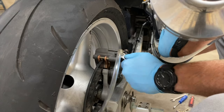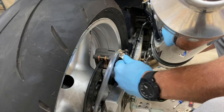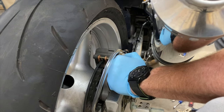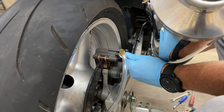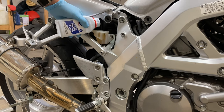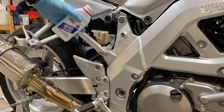Here I'm just making a little container to drain the brake fluid into. To bleed the brakes, all I do is pump the foot lever a few times, hold it down, then crack the nut open about a quarter turn, and just keep repeating that until the bubbles go away. Make sure it's always topped off so you don't run out.